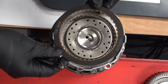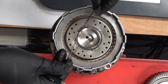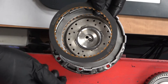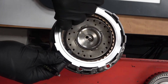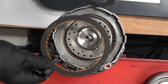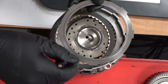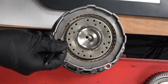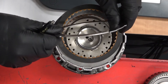Then there's the friction disc, which has internal splines with friction material on both sides. When there's oil in here, the oil creates a barrier between the two surfaces so you don't wear off the friction material — high mileage vehicles can still have readable numbers. The first disc has no internal splines but is tabbed on the outside, fitting into cutaways on the outer housing. The next steel disc is much thinner — these are called steels — and then another friction disc follows.